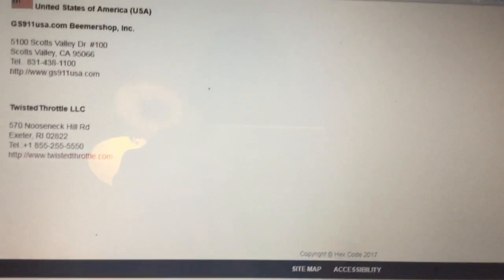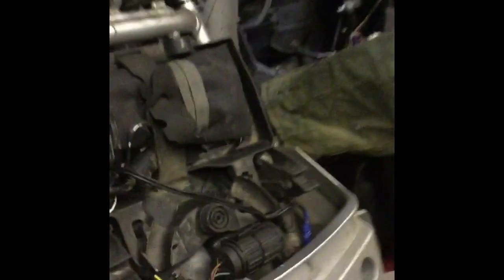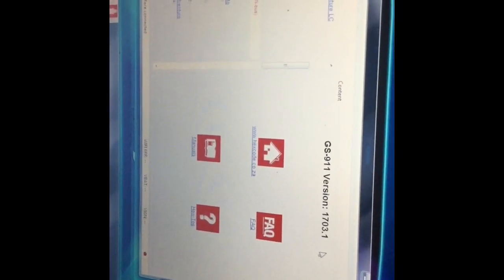I'm going to take this outside and put it on my bike and run through a few of the things. When you take your seat off you get this device, this little connection here. You have to take the cap off and connect your GS into that. Going on to the computer, you'll see listed down the side there all the bikes. On mine you can do up to ten frame numbers, ten VIN numbers, and there are ones you can do endless amounts of bikes on, but mine does ten.